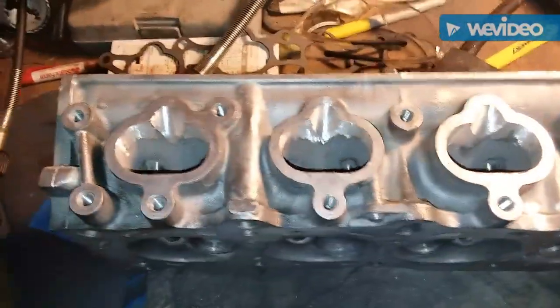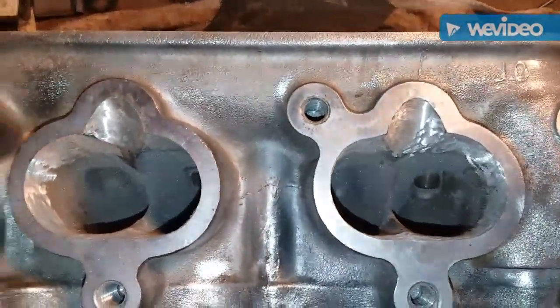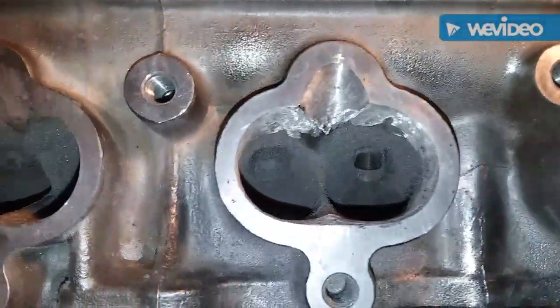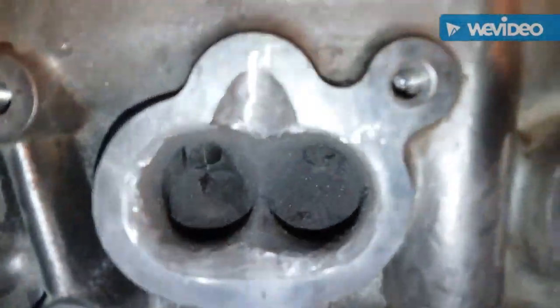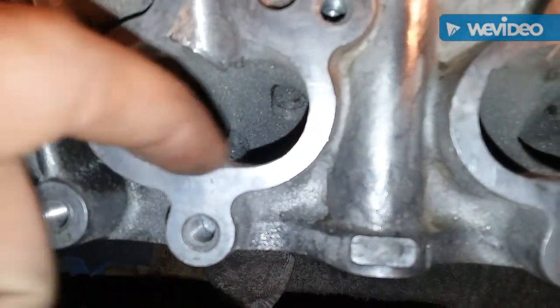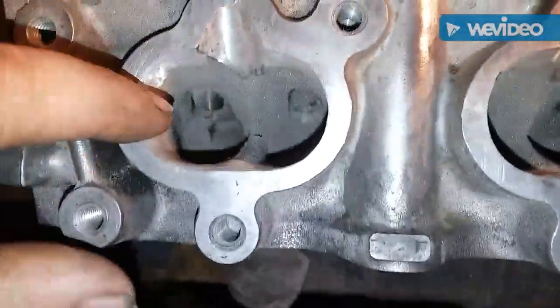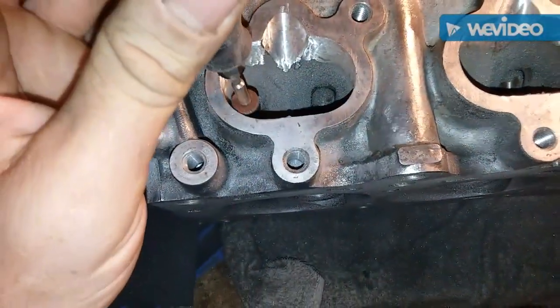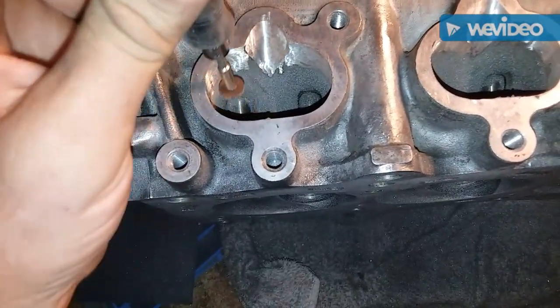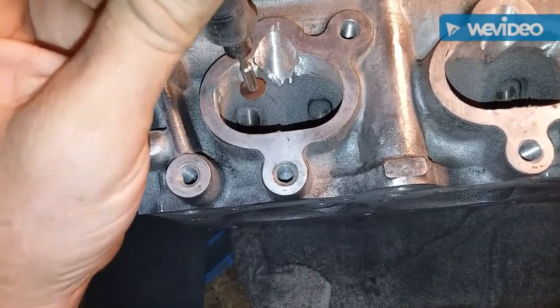Here's what we came up with — not the most beautiful straightest work, but pretty happy how it turned out. Like I said, just grind it down to the lip and then clean it up on the sides and everywhere. Luckily with my little rotary disc I was able to just work it and keep a steady steady motion when grinding — get the edge, and once you get a good edge you just start working it down.